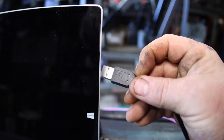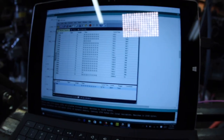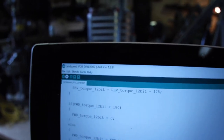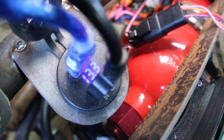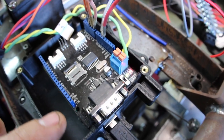Before we get started we've got to flash the VCU. We're getting CAN bus messages. We're going to flash the VCU — compiling — and we are done uploading. Take this back out, plug her back in, flip this on. Negative contactor is going to pop open. Should be able to come over here and get confirmation that we're getting about 12 volts to the VCU. We've got the blinky lights on the VCU slash Arduino — this is a CAN shield on top of an Arduino setup.